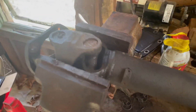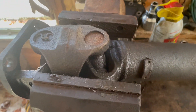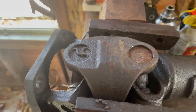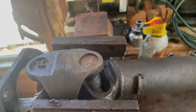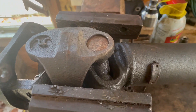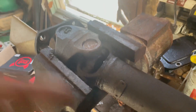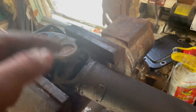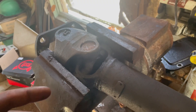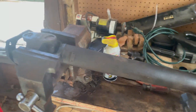Back at the front drive shaft, because it's basically December and we should be expecting snow. For some reason we still haven't gotten any, which works out, but I'm gonna get this in because we're supposed to get snow in like two weeks. Good to have four-wheel drive just in case. I got one clip out, about to flip it over to the other clip and take out that u-joint, then run into town and get the correct u-joints.